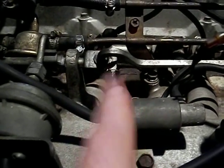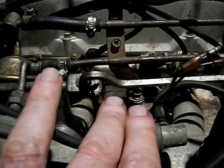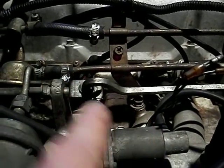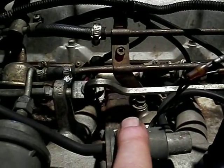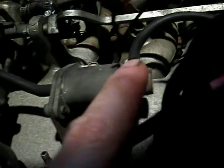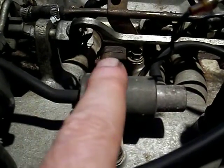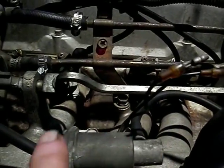So like I said, I'm not sure if it's supposed to be turning on or off when the switch is warmer. And I actually feel a little bit of heat there. So clearly there's power. I guess a third of an amp's enough to actuate it. My guess is whatever the mechanism inside here that turns this vacuum on and off is frozen up. And I don't know if this is a serviceable part. It sure doesn't look like it's serviceable. So I assume it's bad since it's not doing anything, as demonstrated by this test with the power on or power off having no effect. It still passes a vacuum through it.